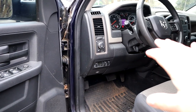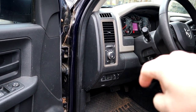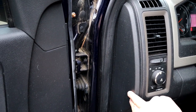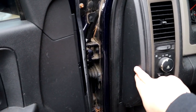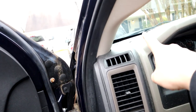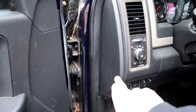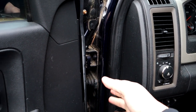Inside the truck now — we're going to run the power cord and the tuner basically the same way I had it on Frostbite. We're going to pop off this side panel and run the Diablo cable behind it, plug it into the OBD port, and then run it up to the top of the dash where the Diablo tuner will stick onto the windshield. The only thing you need to get this panel off is a flathead screwdriver and it just pops off.